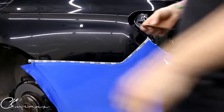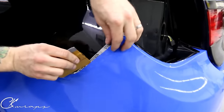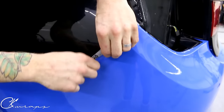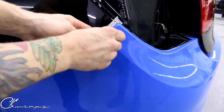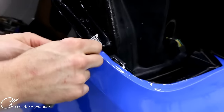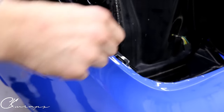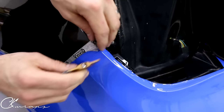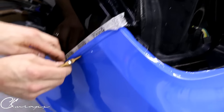Now what we do here is we're gonna lift it up slightly off the tape — it's gonna lift off the tape a lot easier. Then what we want to do is push the vinyl into the recess while it's relaxed. When we get around to the top corner here, what we do is take the vinyl and roll it — we take our squeegee and roll it around the corner. This is our initial push and then we're gonna do one more.